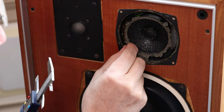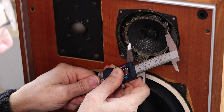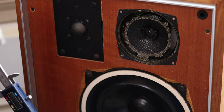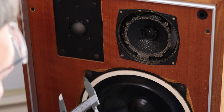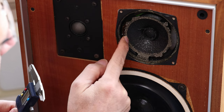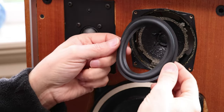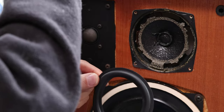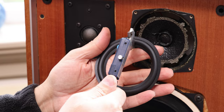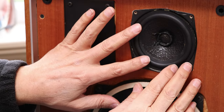The second measurement you want is the inner part, because there's a little overlap — in my case it's 66.5mm. With the outer and inner measurements you get a good idea of what you need. Other measurements include the lip size and overlap. The biggest mistake is to say 'I have a four-inch speaker, I'll just get a four-inch surround' — you have to actually measure the outer, inner, and overlap amounts.